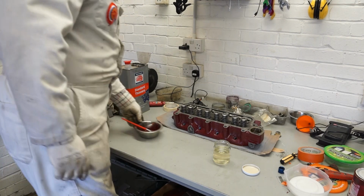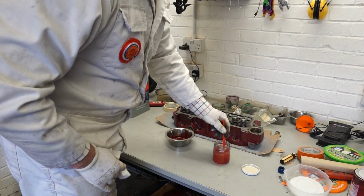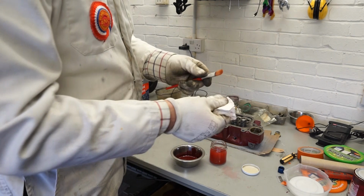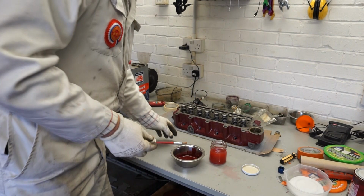So to clean the brush up, all I've got is a normal brush cleaner thinners. Unfortunately, as we've mixed this paint with hardener, we won't be able to reuse that, so we'll have to dispose of it. Luckily, I think the measurement was fairly good, we've managed to get through most of what we poured out. What I like to do is put a little bit of fairy liquid or a bit of cleaner in the bristles. It conditions them and keeps them nice and soft.